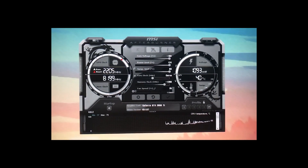Holy crap, it totally works! I don't know why more YouTubers don't suggest it - I guess they probably don't because it's dangerous. What did we get? 2200 from 2140 - so we gained 60 megahertz. We lost about 10 degrees on the core temp. The 10 degrees alone wouldn't account for the extra 60 odd megahertz gain though.